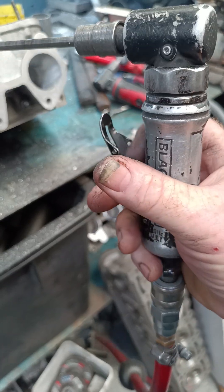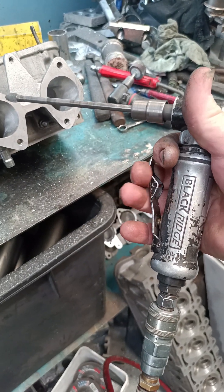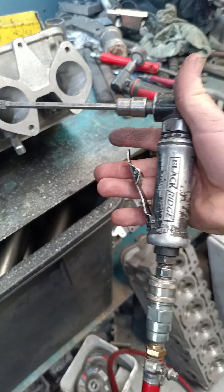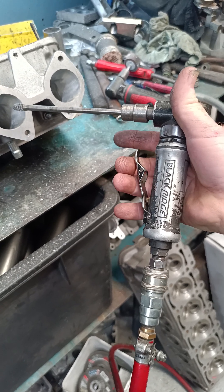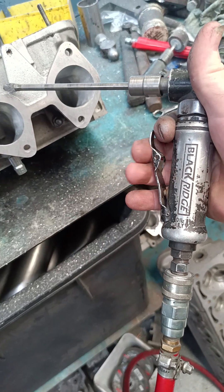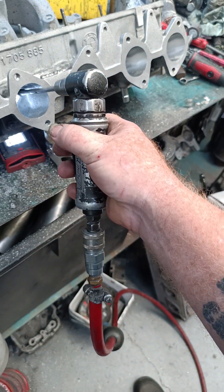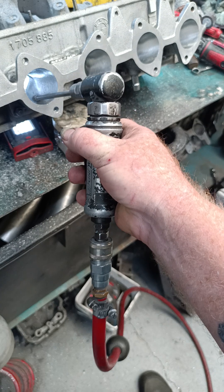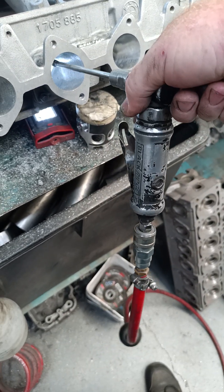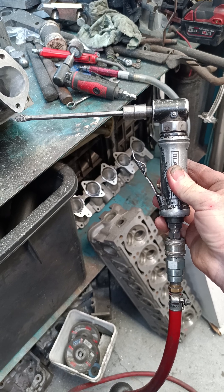All mine are missing their safety because I only ever use a little bit. I've got a big compressor and I can go this fast, but it's not beneficial for porting. When I'm running this in here, I've got a good grasp of it. When you're holding them the other way, they get a little bit out of control. So if you want to do a little bit of cylinder porting, right angle die grinder is the way to go.